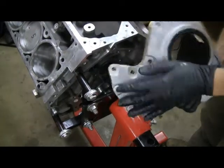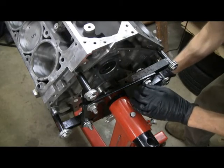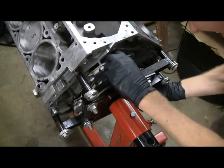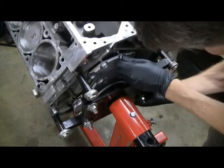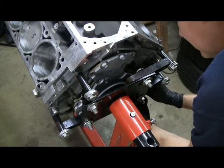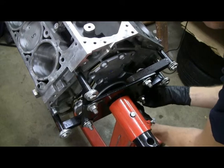So what I did is I took all the screws out except for two, to help hold the gasket in place. It looks like it's easiest to run this thing up from the bottom. Let me just get these top two on a few threads just to kind of hold it in place. So now I'll start a couple of the bolts towards the bottom. One thing to mention is that they say in the instructions to not lubricate that seal that rides around the crank.